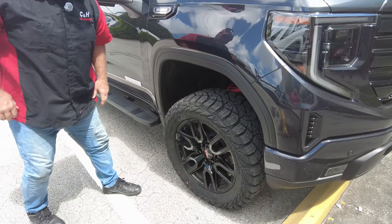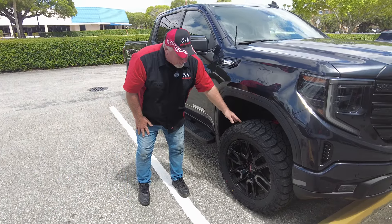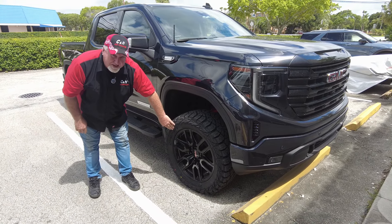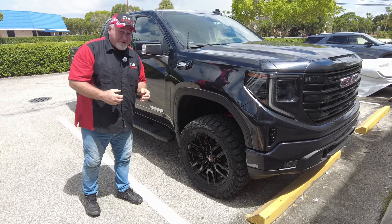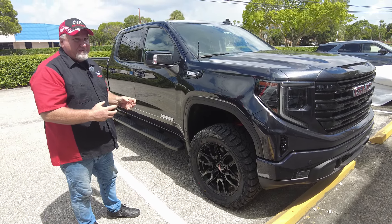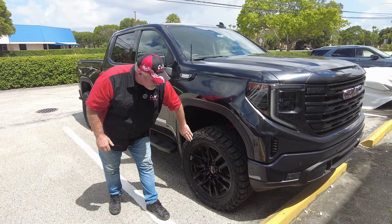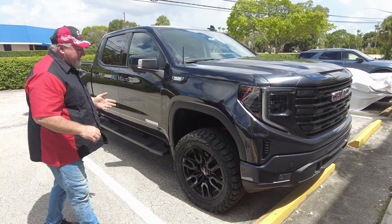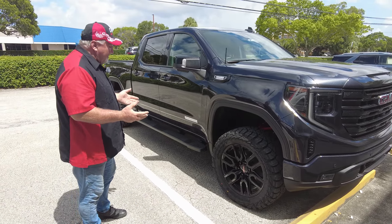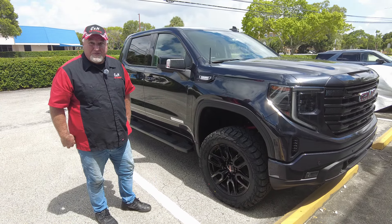I think this is a great look and it rides nice. Now this is a hybrid tire. If you're not familiar with the hybrid tire — you've got your mud terrains, you've got your all-terrains. The RTs are your hybrid, something in between. Basically it's going to ride like an all-terrain so you get good highway performance, but it's going to look like a mud terrain, which has a nice aggressive side. I think these are terrific looking tires, they do have a really nice ride, and I don't find them particularly noisy. They ride very nice and you're going to be very happy with them.